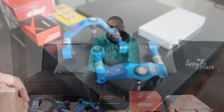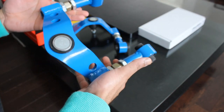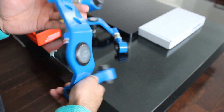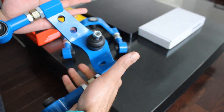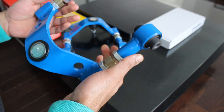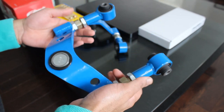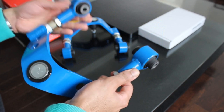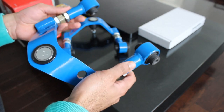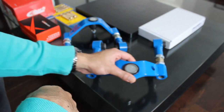The first item we'll have a look at is the Accord Tuning Club camber kit. This is something they offer in Russia and I ordered it and brought it here just in case I would need it to get my car a little bit more camber. It utilizes the OEM ball joint and the adjustments are on the side, which allows you more clearance with the shock tower and the knuckle arm. The main reason I got it was in case I run into more issues with my Skunk2 kit — I would switch to this one. So far the Skunk2 kit's been going okay, and this will be my backup kit.